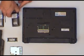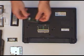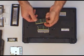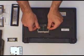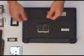Now let's get our other upgrade — that's 2GB in, and here comes the other 2GB. Same again. This is the second slot — there's your slot, there's the guide. In at 45 degrees, firmly in. Make sure that you can't see the gold fingers, and then push down. In it goes.